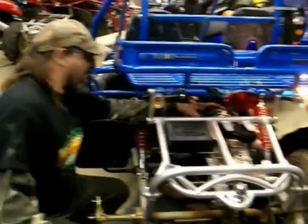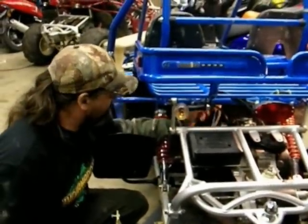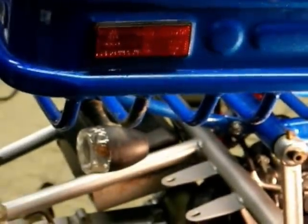We've got the carburetor and manifold back on — two bolts in the back. Hook up your vacuum line. These carbs only have one vacuum that comes from the manifold; there's no vacuum on top, so you get rid of the T and just connect one vacuum line from your petcock to your manifold. Tighten all your bolts back up and hook your cables up. We custom-made an air filter for the customer to rise high to keep it away from water. You can pretty much do anything you want — we used a lot of the stuff already here from the old airbox. That should put a lot of air into the cart.